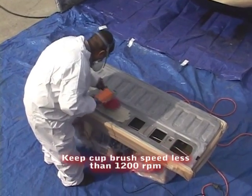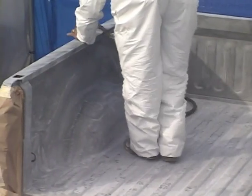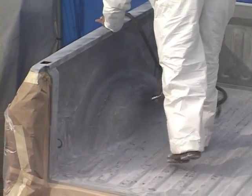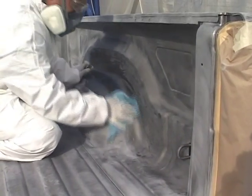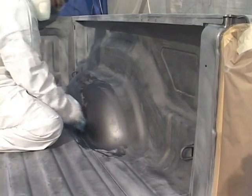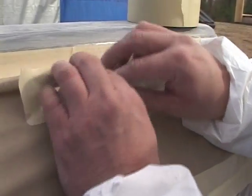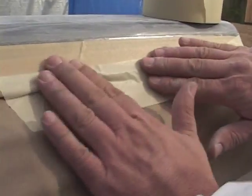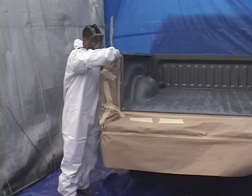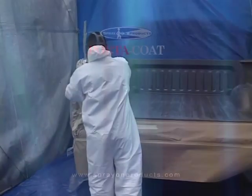After making sure all of the surface area to be sprayed is properly scuffed, use compressed air again to remove all dust and debris. Then wipe the same area again with your cleaner in order to leave a dry surface. Check all masked areas for tears or gaps that may have occurred during sanding and replace or repair if needed. You are now ready to begin the spraying process.